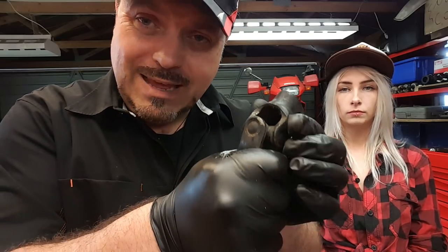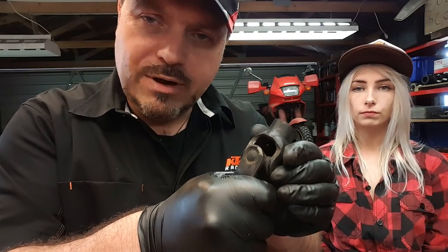And it was a bit of an oversight by the mechanic. It was only when they pulled the steering column out and they couldn't physically move the joint in one of the directions, it was seized solid, that they realised what the problem was. So it's always good to check your UJs. Right. Okay, back to the rack.